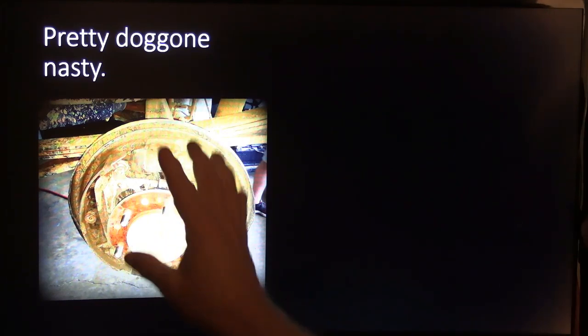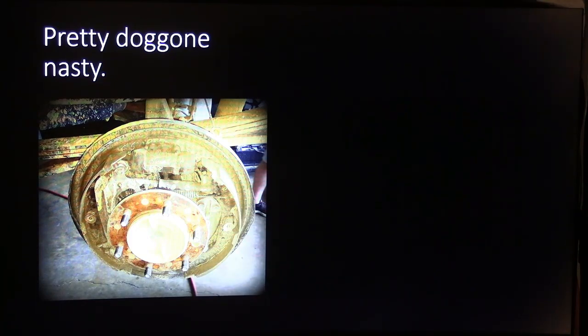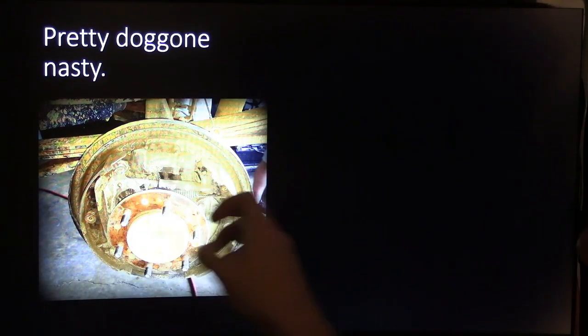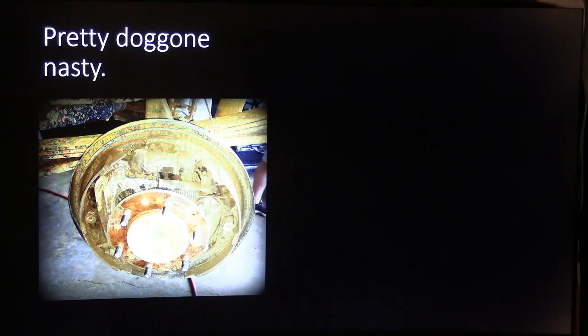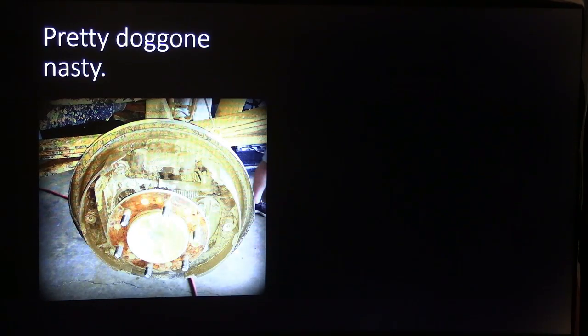Incidentally, if these brakes have a lot of dry dust on them, you don't blow that off with air, because breathing that is like smoking 1,000 packs of cigarettes and it's not nearly as much fun. You don't want mesothelioma taking over you. So you put a pan under here and do it with something wet. Rinse it off with some kind of brake parts cleaner, or whatever, so the dust doesn't float in the air and get in your lungs. But this right here is not brake dust, it's just pure old mud.